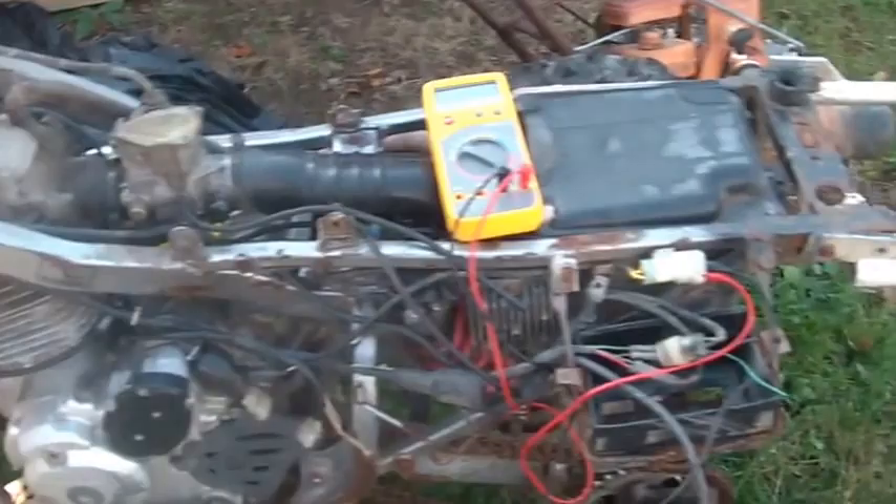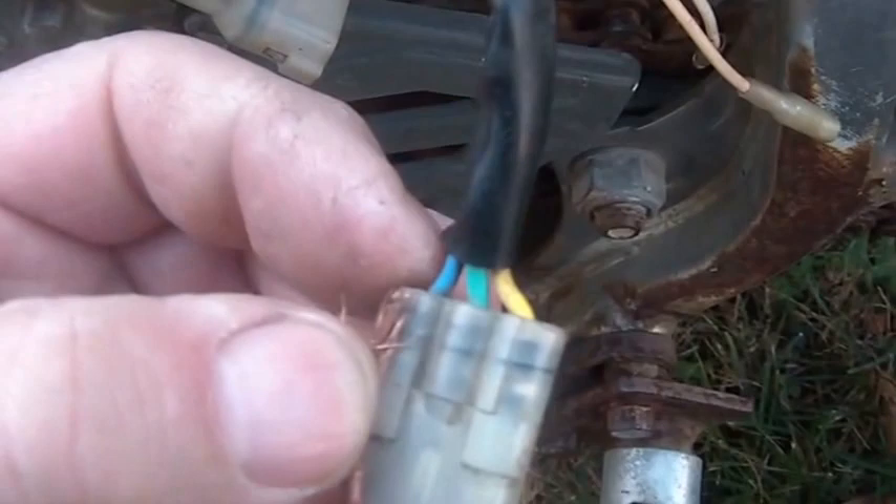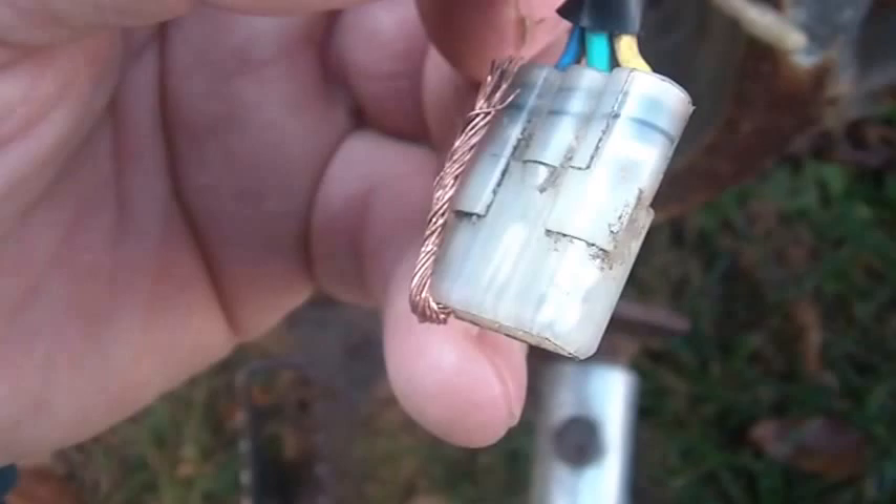After Bill's comments I spent a little more time on it and got a better meter here, just to make sure I wasn't screwing anything up. I checked the wires once again - blue and white is the pulsar, green is ground, yellow in the case of this plug would power the stator, and it powers the ignition system for this CDI over here.